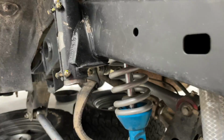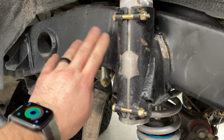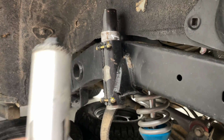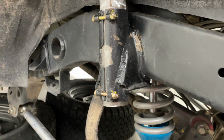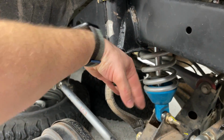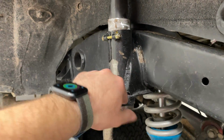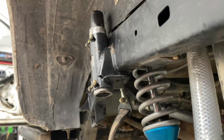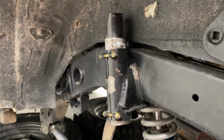How do we fix that? Well, I tried bonking the frame with hammers. That did nothing. And I realized, or remembered, that this bend was because of the mount, right? All of the torque was being induced through the mount of the Hydra bump stop. So you could use the bump stop to push it back into place, and that's what I did. It's now back in line to within about 1/2 degree, which is super freaking cool. So it all lines up with the axle again.